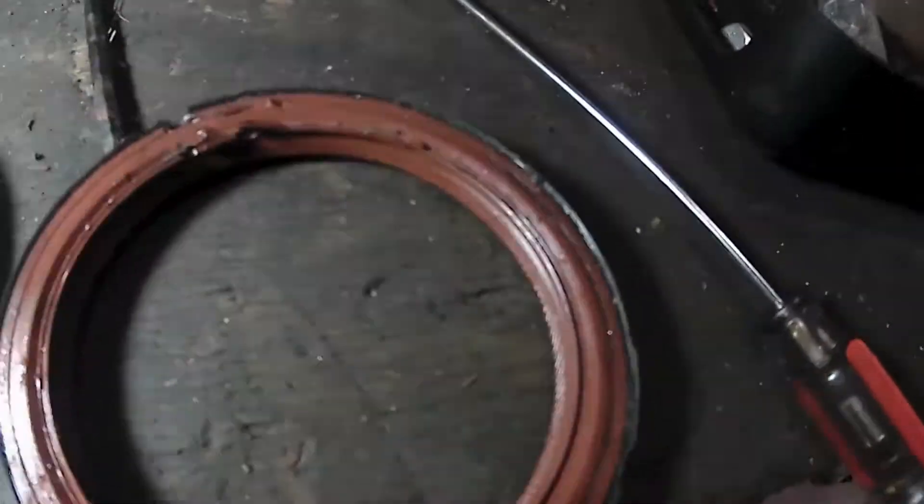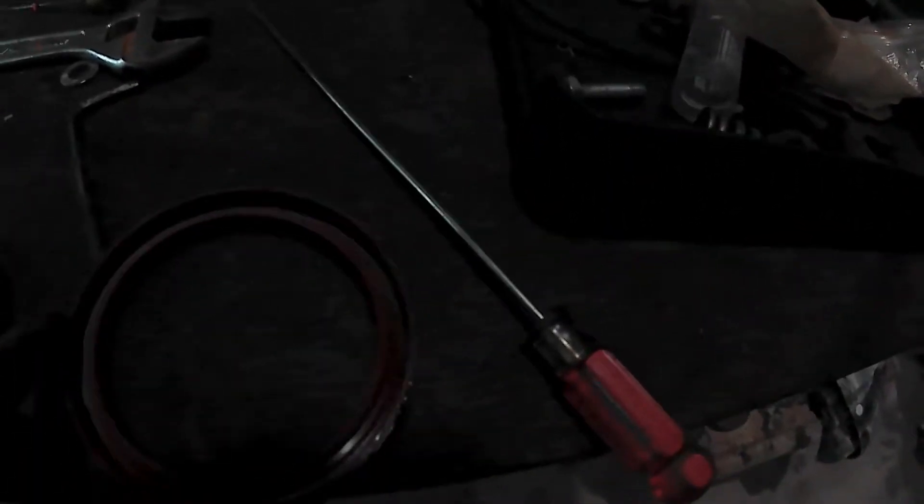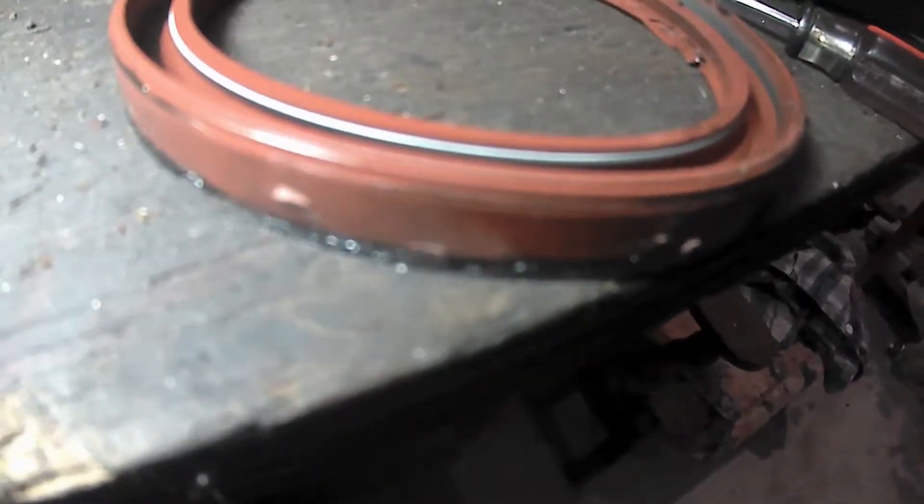Also, I realized the genuine seal already comes with grease packed inside, whereas as you can see there's actually no grease in the non-genuine one. Turning them over so you can see — excuse the light, today I'm on my own — if we look inside you can see that spring ring around the edge. There's a spring going right around the circumference that is tighter than the spring on the non-genuine part.